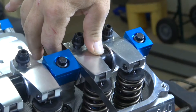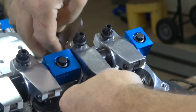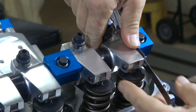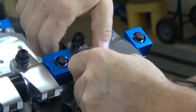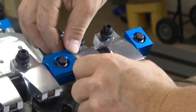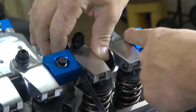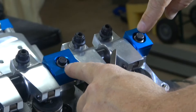Push that that way and look at the end of the valve. Make sure the roller does not come off on the other side. I have 30 on this side, so that gives me 60. If I go 20 on this side, that doesn't push it too far — it actually centers it pretty well. So 10 and 10. I want to be at 60, so I'm going to put a 20 and a 10 in here. I'll push the rocker all the way over and make sure the roller doesn't come over the edge of the valve tip. So if I put 30 on this side and 30 on this side with nothing in the middle, no shims in the middle, I'll have this centered based on where the clamps are placed.